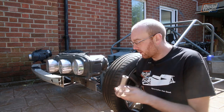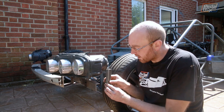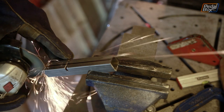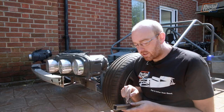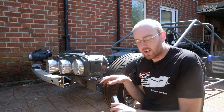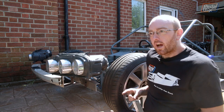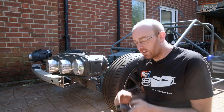Instead, I've got some inch box, and I've cut a 10-mil deep groove into it, and that fits over the end like that. I'm going to split this in half so it's only going to be half an inch thick, but that will fit onto there, and then I can drill a nice wide, almost inch-thick hole, which will allow this peg to move with all of the other adjustment points. The reason I've only gone 10-mil deep is because edge-to-edge here is 1,790 mil, and the main car at the midsection point is 1,820 millimeters, so there's a 30-mil discrepancy. To make life easy, I want a nice flat edge for the tire, so I need to bring this out 15-mil on each side, which this will do.